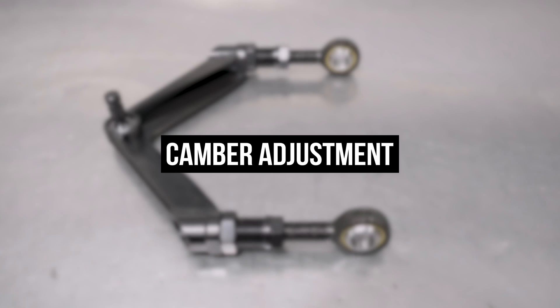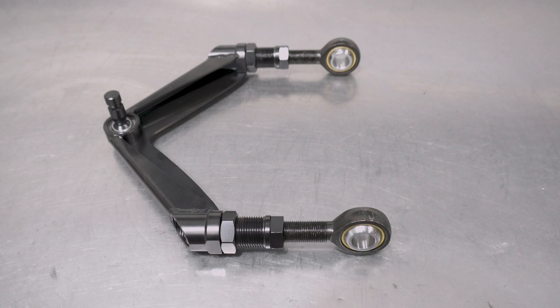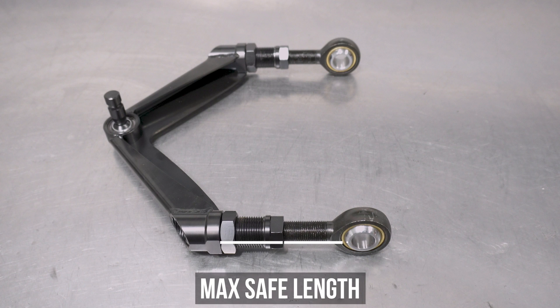Now let's compare lengths. The best way to start, as with all of our other arms, is to get it to the max safe length of adjustment and wind them back to OEM or wherever you want them. This way you know you have 100% thread engagement. In this case, the max safe length is 106 millimeters, measuring from where the lock nut bottoms on the arm to the start of the bearing. The sleeve portion of the extender is made up of 42 millimeters of that, measuring from the same spot on the arm to the start of the lock nut above the extender. That leaves 64 millimeters of threads showing on the heim itself, starting from the top of the sleeve under the lock nut to the start of the bearing.